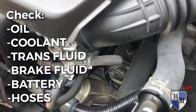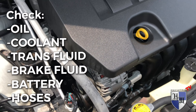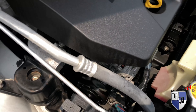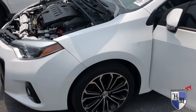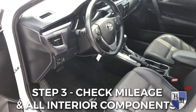Check the radiator overall, and look around and inspect for leaks. Make sure there's no head gasket leaking, no valve covers leaking or seeping, anything like that. Check underneath the car for any leaks as well. This car looks really good — this is something I'd definitely pay top dollar for, because if I do, the consumer would definitely pay top dollar for it as well.